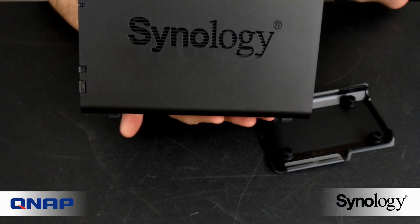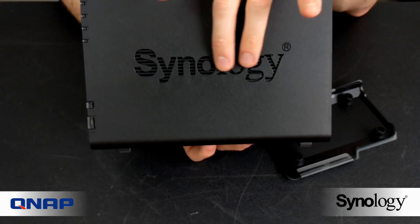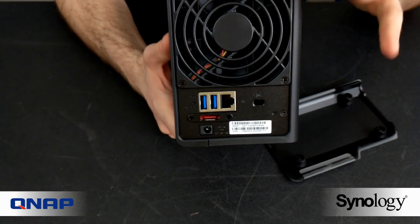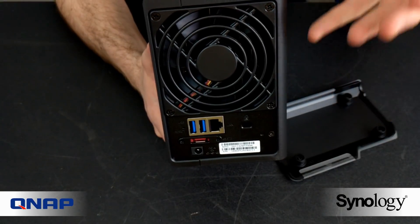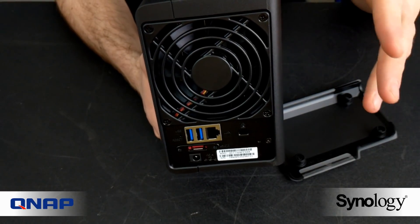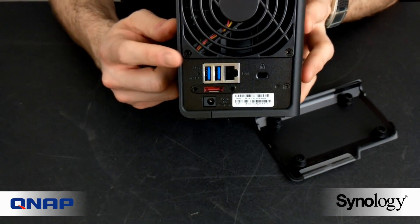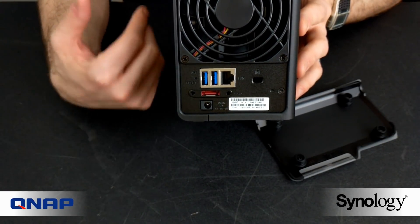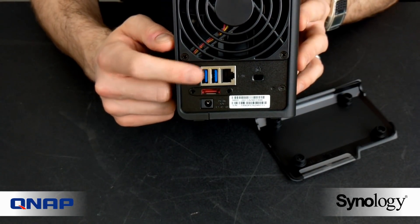The sides of this plastic chassis have the Synology logo ventilated through them, providing airflow from the rear fan. That single rear fan can be fully controlled — the RPM can be increased or decreased manually or automatically to heighten cooling or lower noise. The LEDs can also be dimmed or brightened as needed. On the back there are two USB 3 ports supporting external hard drives and peripherals such as UPSs and wireless dongles, plus one RJ45 LAN port for network connectivity — so no link aggregation here.